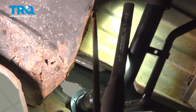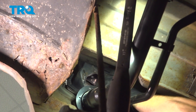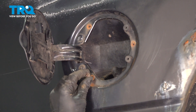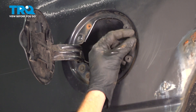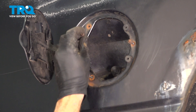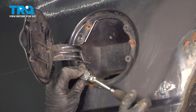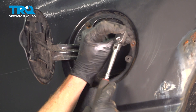Let's get ready for the installation of our filler neck housing. We'll come up through the backside of that fender and put this in the proper position. Once you have all three of your mounting holes lined up, we'll continue on with starting in each of our three mounting bolts. After they're all started, you can go ahead and snug them up. Just make sure it's nice and snug — do the same to all.